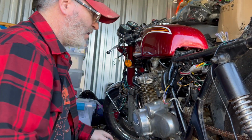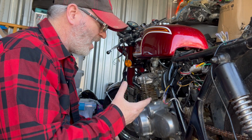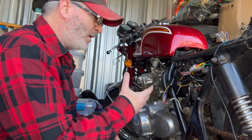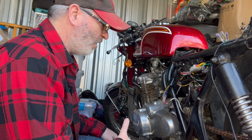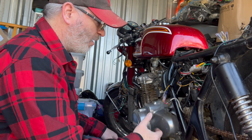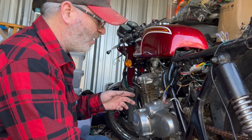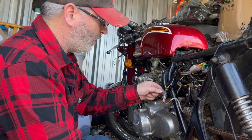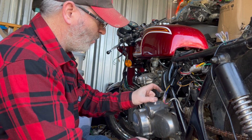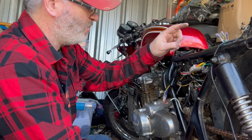Well, so what I did is, this is like a Dyna S electronic ignition, which is like a $175 pointless ignition. That's what we've discovered. And there's two red wires, which is the power that's supposed to go there. You're supposed to give it 12 volts. They said give it a switched 12 volts, which really the black wire is. And I can just make a little Y adapter here, because we still need one of these for the brake switch that comes over here.